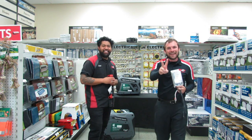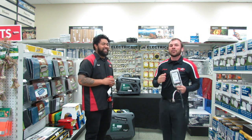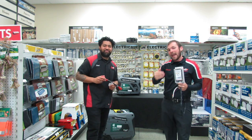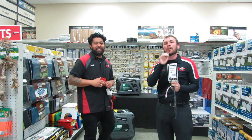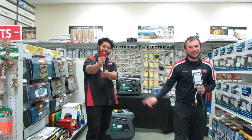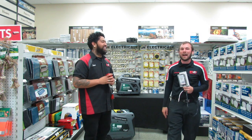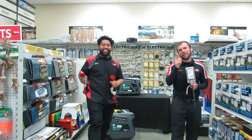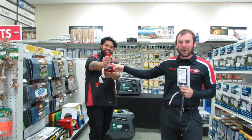We can also add a second AC to your 30 amp RV, and instead of spending all that extra money to run a 50 amp system or add another cord, we can now install a second AC with the Easy Start device installed and run that RV off of 30 amps. Also, we've got your 50 amperage covered as well. We can now install two of these Easy Starts in an HVAC on your 50 amp RV, and you can run your 50 amp system on a 30 amp cord.